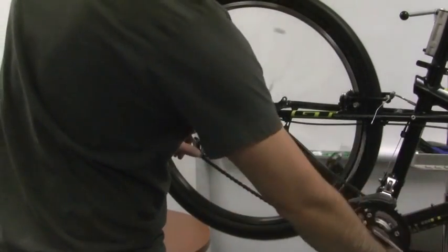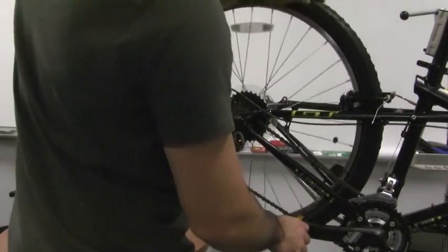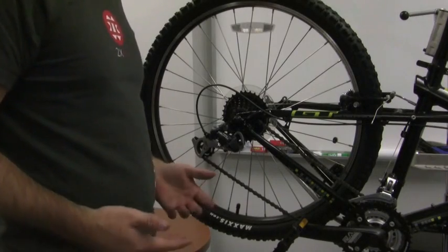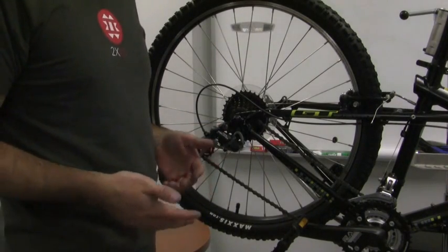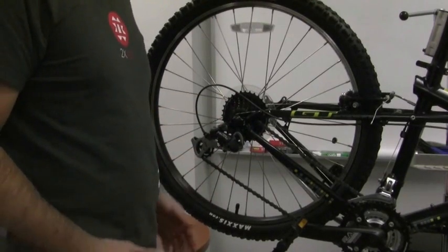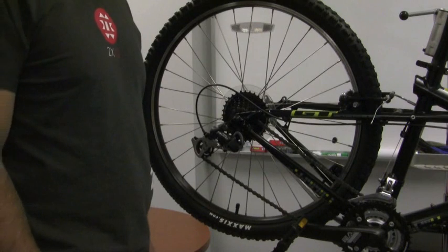You should find that your hard work of setting your cable tension, limit screws, chain, and shifters has all paid off, and you should be good to go. A lot of times you can bend the derailleur hanger by falling on the side of the bike that has the derailleur, putting it in the back of a car, or leaning it up against something. These are usually pretty soft aluminum and they'll bend pretty easily, so that's something you can check optionally if your shifting is still not working after all your other adjustments.